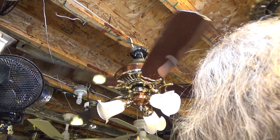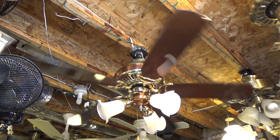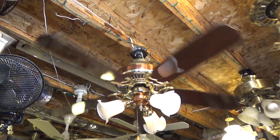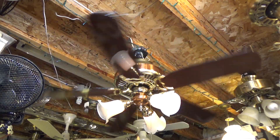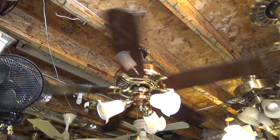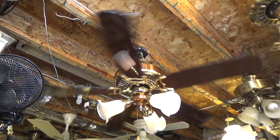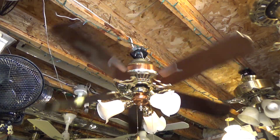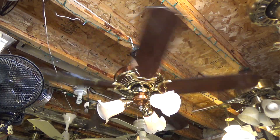Let's go to speed 2. This is now 7 microfarads. I intended this to be like a functional low — now I can feel not a substantial breeze, but it's enough to have no doubt that the thing is on. It's a very quiet fan, completely inaudible at this point. Maybe 65 RPM somewhere right around there, and it's got a decent airflow to it — you're going to feel this in the room.